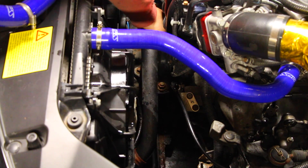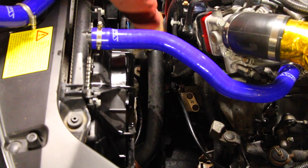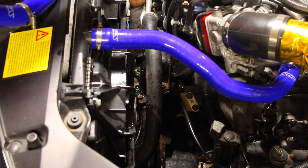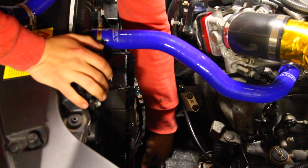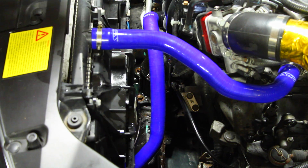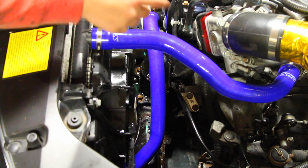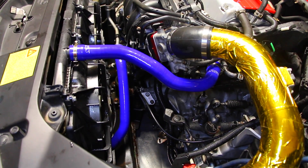We need to move down and this tool is going to be very handy to take off the clamp found on the bottom side of the rad. Whenever you're ready you can go ahead and pull off both this side right here for the coolant hose. There's one that's off and leaking, and you're going to be doing the exact same thing to the one down here for the lower rad. Now is this job easy? Yes. Is it messy? Yes. As soon as you put these two lines on and clamp these two pieces down just like we did before for the upper rad piece, all of this part is going to be done.